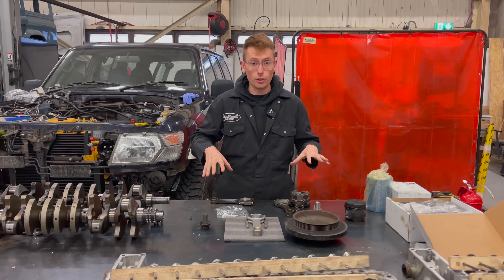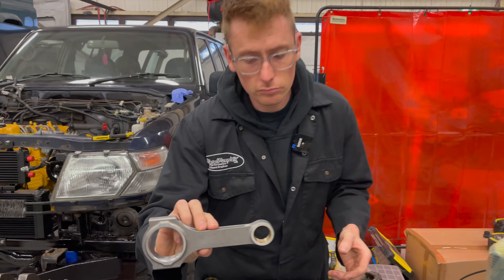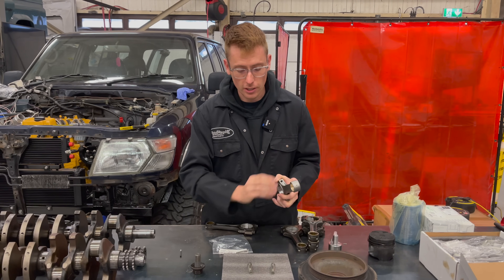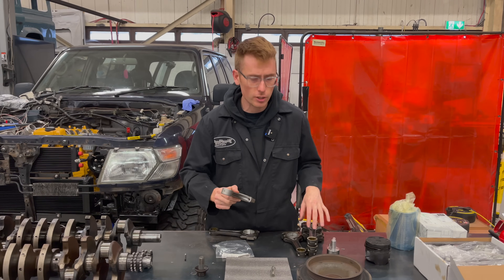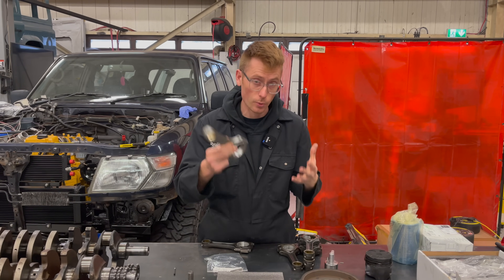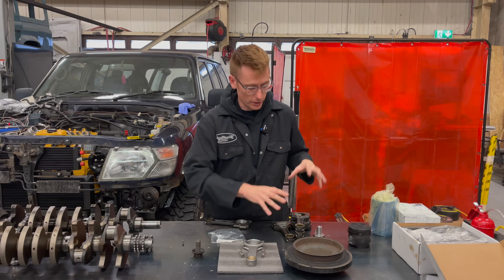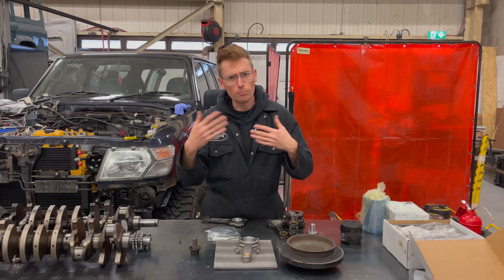The first fix for that issue is an upgraded H-beam connecting rod. These rods are not particularly expensive, nothing particularly flashy, but stronger than the original. They're a forged H-beam rod — they take the power and we're not having the same bending issues with these. They come with ARP fixings that are a little bit larger than the originals, and are marginally heavier than the originals. You can check the weight comparison on our website advert. All you need to do is make sure you get that bearing sized correctly to your piston pin, then fit them in the engine. They're available in standard length, which is what the majority of people buy, and also in a slightly shorter length to allow you to fit the crankshaft out of the 320 CDI.